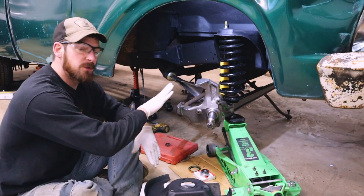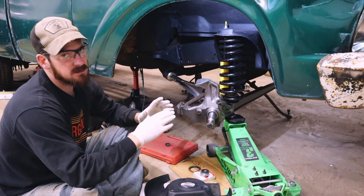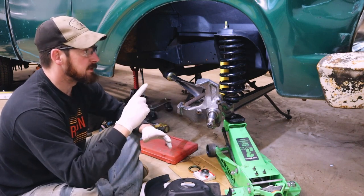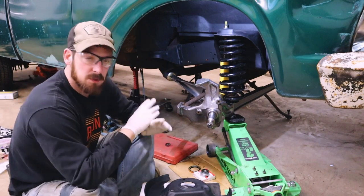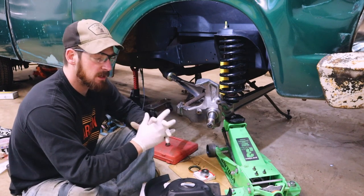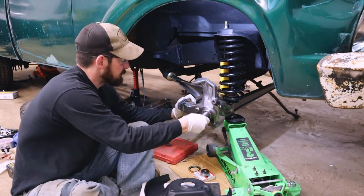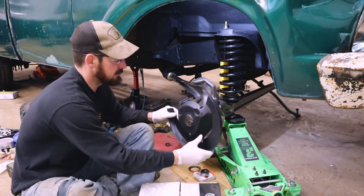We need to put the backing plate on, then get the bearings packed full of grease, put them into the new discs, and put all that together, then put the calipers on. I haven't painted the calipers — I'm going to put them on the truck, make sure everything fits, then paint them after. Because I put the dual master cylinder from the '76 on here, I have to plumb all new brake lines, I'm putting a new proportional valve, and I'm going to flare all my ends and make all lines from scratch. Let's get this freshly painted backing plate on here.